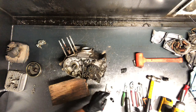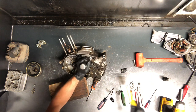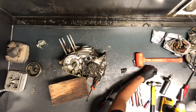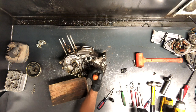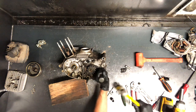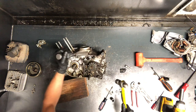Sensor's ready to come out. You do have to remove this — I don't like to use my impact on this one. When we're splitting the case, you've got to remove this one, otherwise this little arm here will hold us up. It'll bend out of the way but then you've got a bent piece. So we've got Phillips all the way around here — we'll remove those. I like to take a screwdriver, clean them out really good, then take your impact driver and put it in there. Make sure it's seated really well before you slam on it. As I've said in past videos, this impact driver on an older bike is just about required.